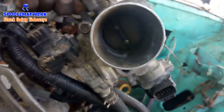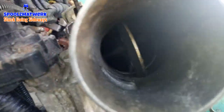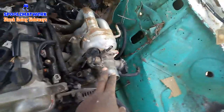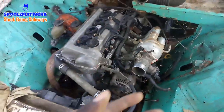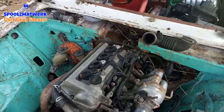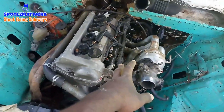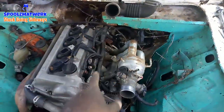I'm building a front-mounted intake from the 4E original manifold. I've built an adapter plate — just put it on to check, and it goes right through, nothing stopping it, everything is in line, straight into the intake port. This is the original 1NZ throttle body, so everything is lined up. I cut the adapter out of hard plastic with all the bolts, and I'll cut the final version out of an aluminum plate.